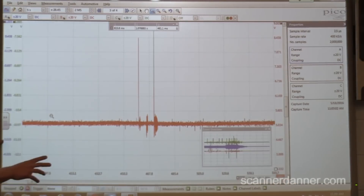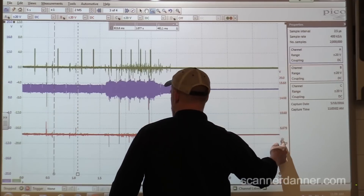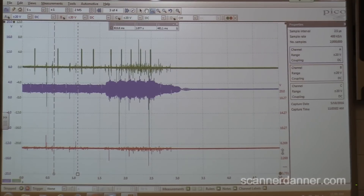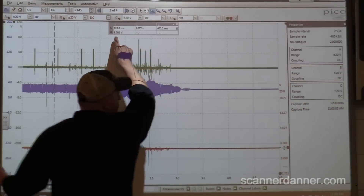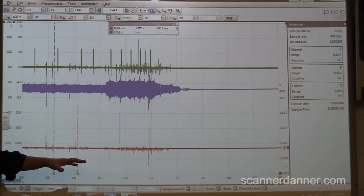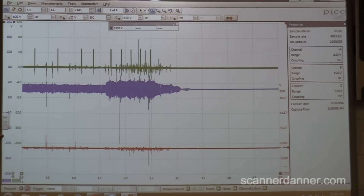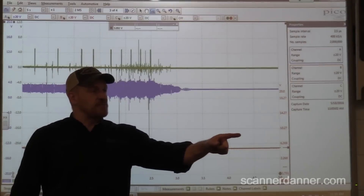We have one cam pulse that occurred here — actually, that isn't even a cam pulse. That's just noise. We have no cam signal here at all. Did you plug it back in? The voltage on this cam sensor is a steady 5V on my signal. Is this a 5V pull-down or 5V pull-up design? Without a cam signal, it looks like this system can still fire the coils — but that doesn't explain why we didn't have spark.